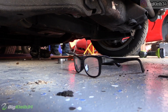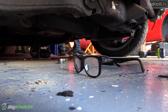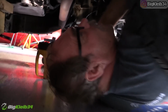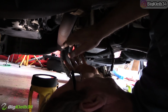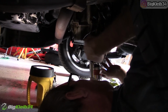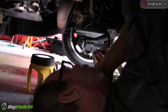Do it again? Yeah, came from the back that time. One more time. No, it's not doing it now. So what'd you find? Look, can you see under here? That wire, kind of. Yeah, the end of that, the insulation's all eaten off of it, dried up and broken. The other end was leaning against this stud here, the other stud on the starter. So it was arcing and making some bubbling down there.